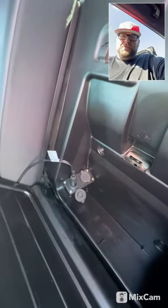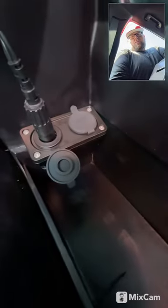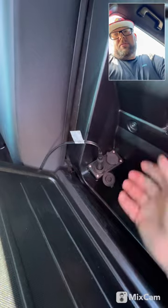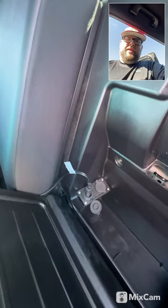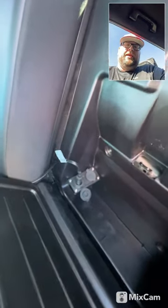The last thing I want to show you is it does have a Dometic fridge freezer — it's not in the truck right now. We did have a little bit of an issue with the power outlet we used originally. Now that we are a true Dometic dealer straight from Dometic, we run their 12-volt supply that they offer. Instead of having a hole in the side with a connection we build, it's a 90-degree angle so the connector wire comes straight up and tucks out of the way a little better. I've got it plugged in inside right now getting back down to temperature — you don't want to plug it in at 70 degrees internal temperature; it will pull the battery down. But plug it in at 33 degrees and it maintains, kicks on and off as it needs to. It tucks away back in the storage compartment, and we run the wire underneath the truck.